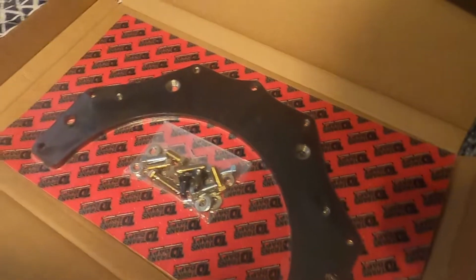I haven't done this before, but I have a friend that's done it, and he says that there's one bolt on the LS engine that you can't use with this adapter plate. So you'll only have 5 engine bolts or bell housing bolts instead of 6. But it holds up fine and everything still works.